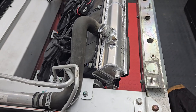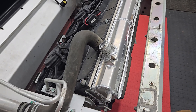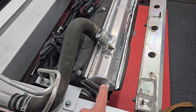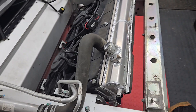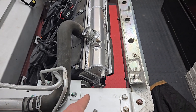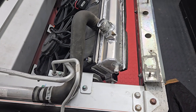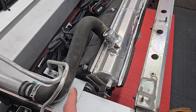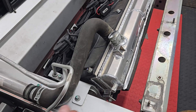Not sure how many people are going to be affected by this, but this is an aftermarket Wizard radiator that I've installed in my Lotus. The 2011 Lotus Evora S1 has the same port, but it's blocked off from the factory. I don't know why the aftermarket radiator has it — the auxiliary radiator doesn't plumb off of that, as far as I know. I don't know what other features would use this. It does blow through on the S1 aftermarket one; on the stock one it's blocked off — you can't blow through it. So that's an easy way to test.